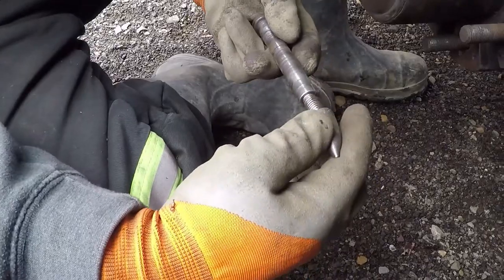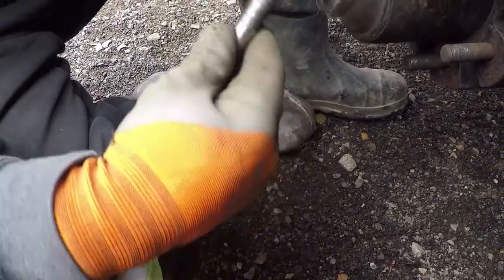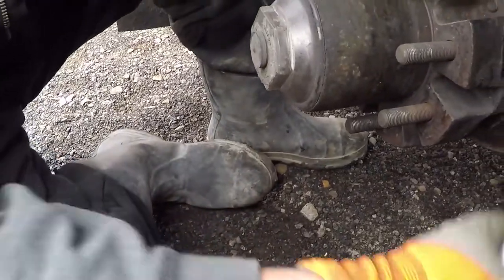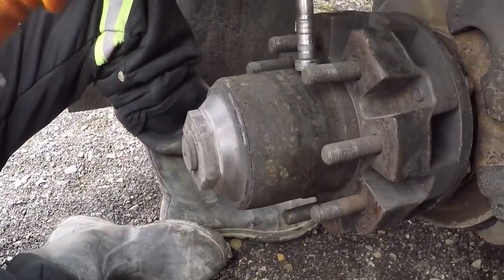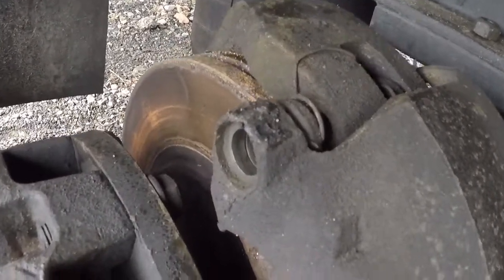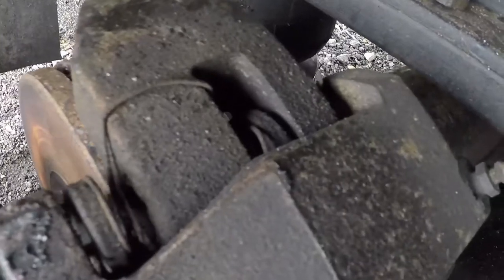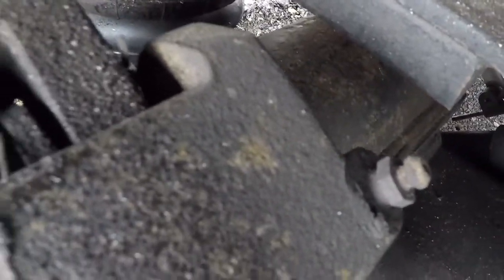The bullet that comes in the brake kit — if you get the brake kit — makes it a heck of a lot easier to go back together. Get the bullet. It aligns the caliper with the pad, with the first side of the spring into the bracket, and then the other half of the spring and other pad through the bracket again and back into the caliper.